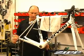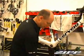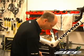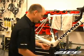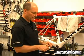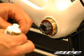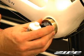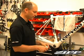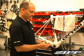All right, now we're ready to install the drive side arm. First thing you need are your spacers, shims, and wave spring. First part to go on here is the aluminum spacer. Just want to put a thin coat of grease on this spacer, as well as the wave spring and shim. This just helps to reduce any potential creaking or anything. So the next thing to go on is the wave spring.